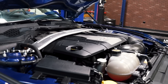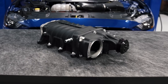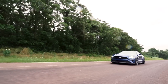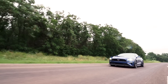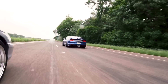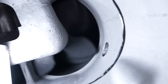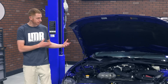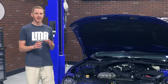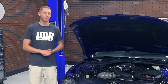Because of those engineering development efforts between Roush and Ford Performance, this supercharger kit will unleash the Gen 3 Coyote's full power potential with a staggering engine power rating of 700 horsepower and 610 foot-pounds of torque at 12 pounds of boost with 93 octane fuel. The TVS R Twin Vortices Series supercharger technology brings unparalleled reliability and performance and has proven itself for years in prior supercharger packages and production cars built by Roush themselves.